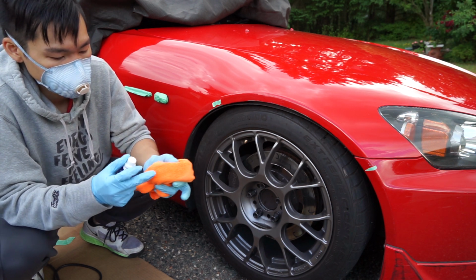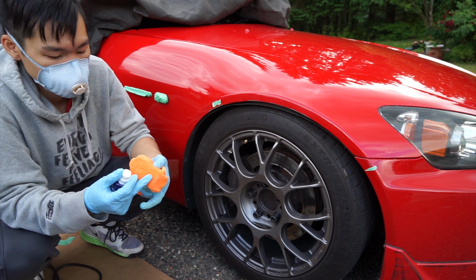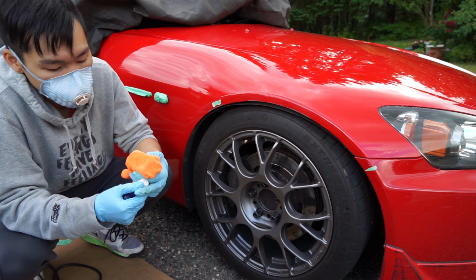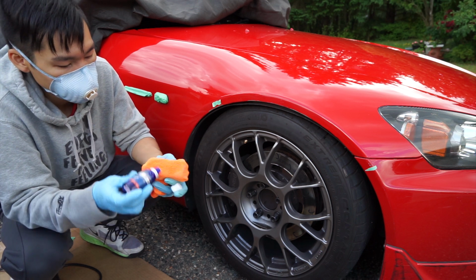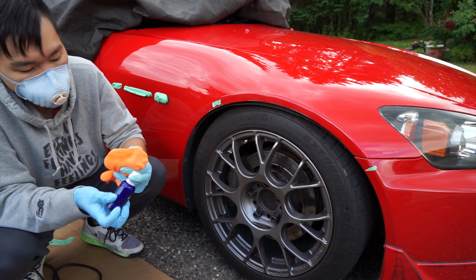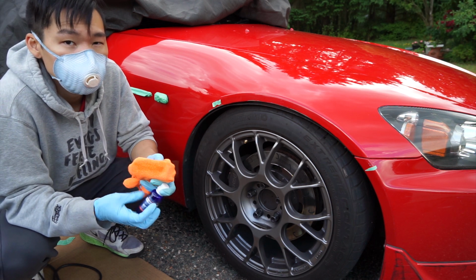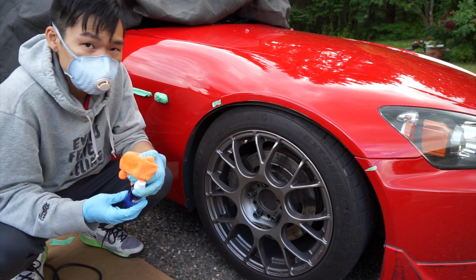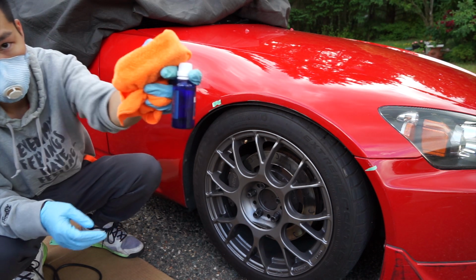So I'm going to be using a throwaway microfiber towel. These are good because there are so many different places you can use. Once one spot gets used up, then you could just move the block to another part of the towel. But in any case, what you're going to do is take your ceramic coating, make a few lines down the middle, and this should really be all you need to coat the entire panel. This may be even a panel and a half worth of coating. I've done about 6 or 7 cars with this one bottle, and you can see that there's still a ton left.